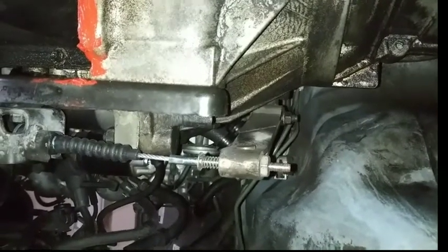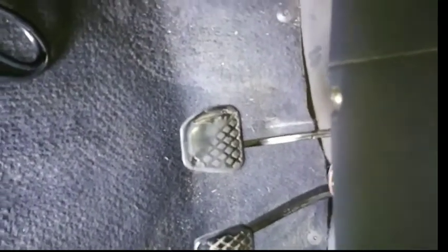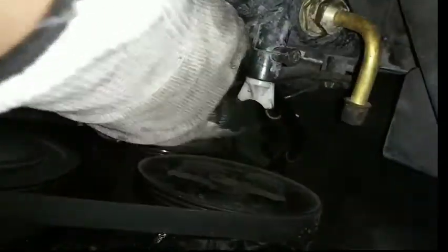I might have to adjust. My pedal actually has resistance now. Pretty much adjust as needed and test drive. Make sure you snap all of the clips in place — there were three in this case — otherwise you run the risk of your new clutch cable running into a belt. Also verify that the cable is not hitting anything vital or moving, so there's no chance of damage. With the exception of that clip that I need to push in, it seems fine.